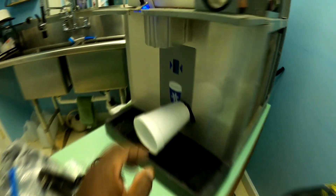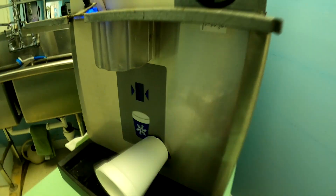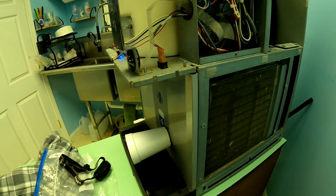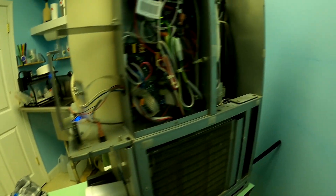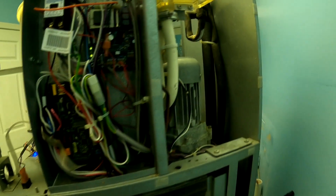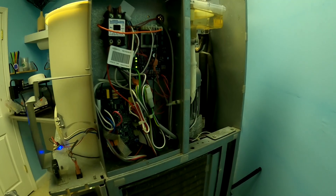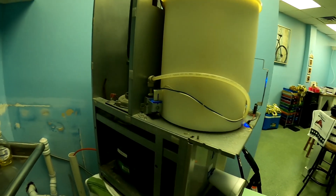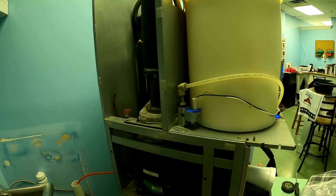They have this little standalone machine at a cafe making nugget ice. The way it dispenses is there's a sensor here — you put your cup right here and the motor just dispenses. But the motor is locked up. I've been able to break it free a couple of times and let it spin, but that's the issue. Simple machine, simple concept, but you can fix these things and make money. I'm going to talk to the owner, they want it fixed, and we'll schedule it and order the part.